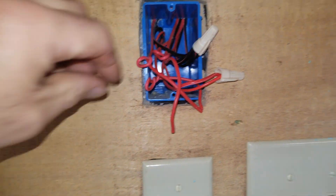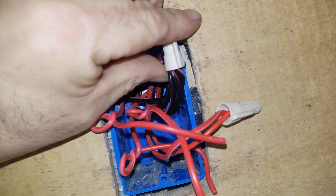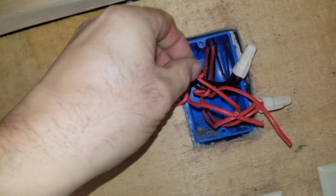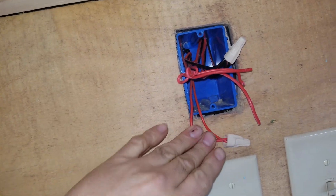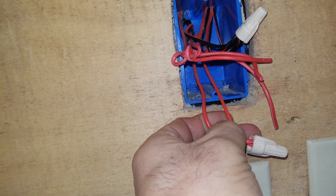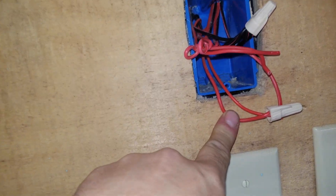All the negatives are tied together — you can see all the black wires, those are negative. The hots for the switches we call switch legs, which I always mark by a little twist so I can tell these are switch legs. These two are just hot — constant hot. I can tell because they're different types of wire. They're both red but different kinds. This one goes down to the lighter plug and this one is the positive from the fuse box.